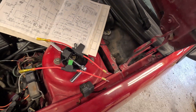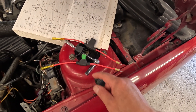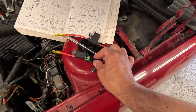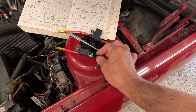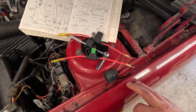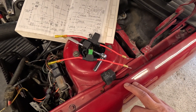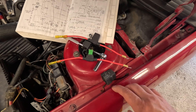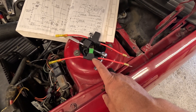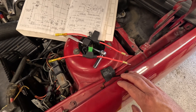Today we'll look at replacing fusible links with the little fuse J-case fuse holders. They're time delay like a regular fusible link but they use a small J-case fuse. They come in many varieties — generally the 10 gauge unit can do up to 40 amps max and the larger 8 gauge unit can handle 60 amps. While they come with a very nice heat shrink tube on them from the manufacturer, I needed to modify that connection, and where that happened I made sure to use some nice dual wall heat shrink tubing.